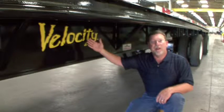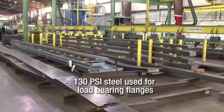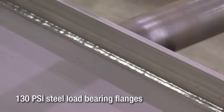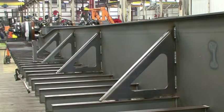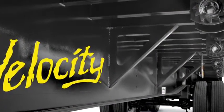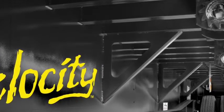The strength and backbone of all Fontaine trailers begins here with the extreme beam. The fabricated steel extreme beams used in the Velocity trailer are constructed using top and bottom flanges which are joined to a single one piece web by continuous full length welds on both sides making it a true I-beam. These fabricated main beams are made with positive camber in order to accommodate expected loads. The Velocity features one piece fabricated steel side rail braces and supports which are spaced approximately 60 inches apart. These serve dual purposes both to strengthen the main beam web as well as providing heavy duty support for the outer side rails and deck.